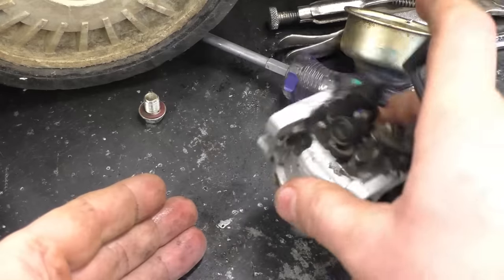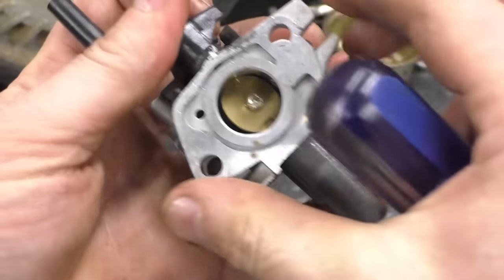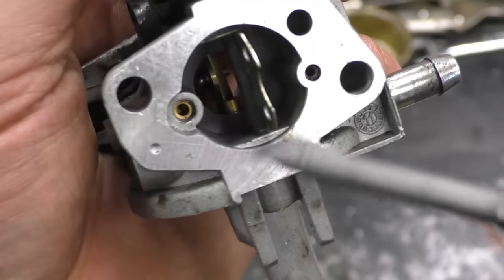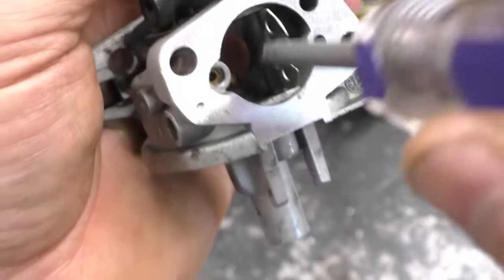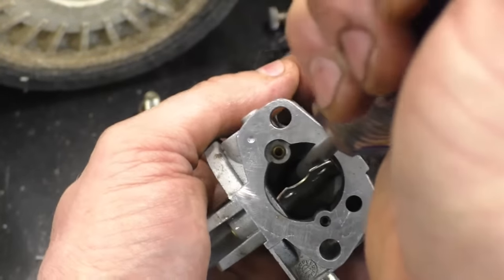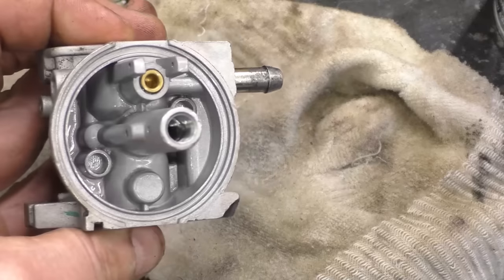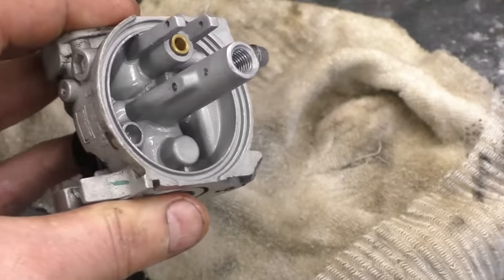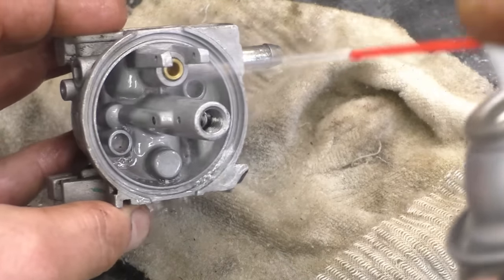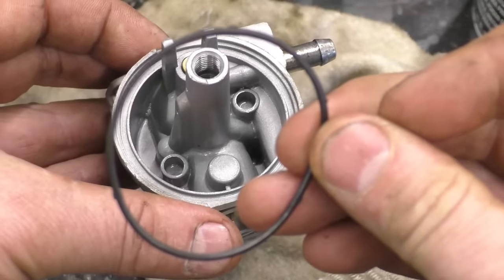There we go. There's another tube in there called an emulsion tube — I like to pop that out to make sure the carburetor is clean inside. You can see the tube, it's brass, sticking out right there. I go in and push it down with the screwdriver. Now what I do when the carburetor is pretty clean like this is just spray carb cleaner to give it another good final clean. There's no corrosion, there's no old gas that's built up.